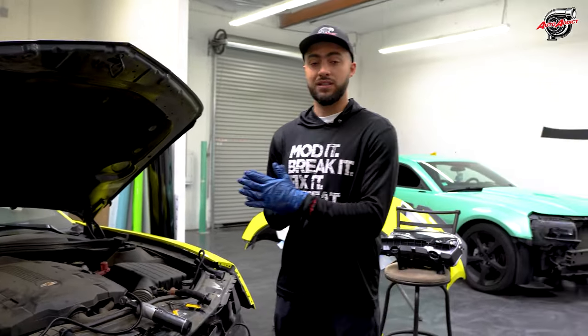As you know, this is where all the juicy and technical stuff goes in here. But the fuse box number, you'll do that last, till everything's connected. So there's going to be two sets of plugs. One set of plugs is for your fog light to make sure it functions, and the second one is for the headlight. So we're going to do the same replicated way that we did for the driver's side. Run the wires underneath, make sure it doesn't interfere with any wires, so we should be good to go.